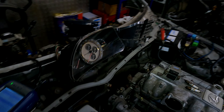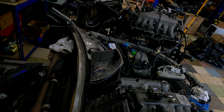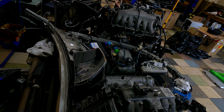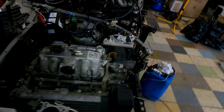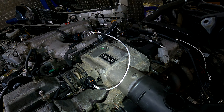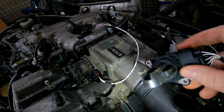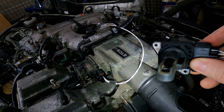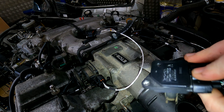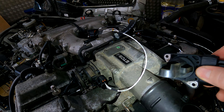So you're going to hear how it's going to struggle to start and it's not going to read the airflow properly. You would think that these little MAF sensors, because they're so small, would read the air no matter which way they are - I mean it's a mass airflow sensor, just passing air over a wire. But that is not the case. Put these the wrong way around and they are really not happy at all.